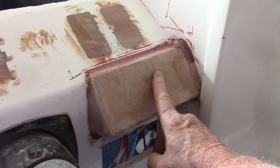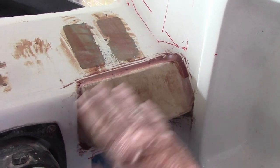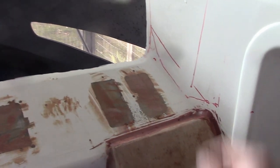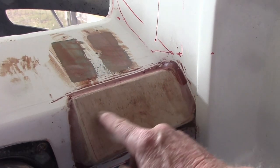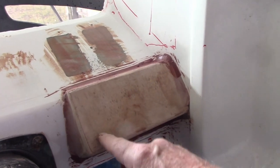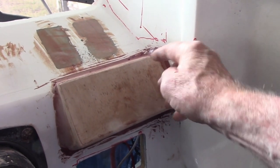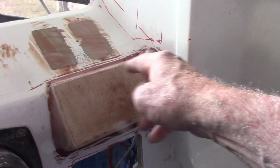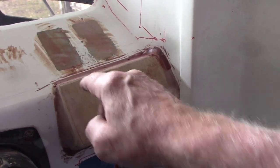I've got the bracket where I'm going to mount the VHF radio bogged in place - some of it's still wet and setting. I've got to glass over that, and I'll glass over it once I get all this sorted out up here and get the dashboard in. I'll just glass that all in one piece, all down there round and down. I haven't cut the hole for the radio yet because I'm going to drill the corner holes, and I need this ply to hold the hole saw straight while I drill through into the proper glass behind it.